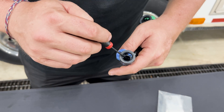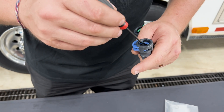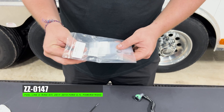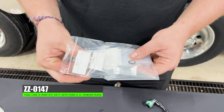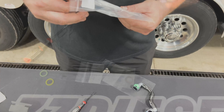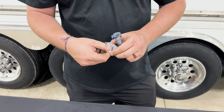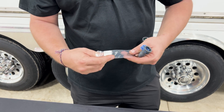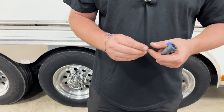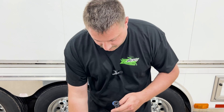Again, there is a separator piece of plastic in there, so you want to locate that and know where it's at. When you grab your O-ring packet, we have them all labeled. This is the short fuel line blue connector side, the one we just removed. You have a black and a brown. We're going to put the brown O-ring on the innermost part. On all the connectors, the brown O-ring will go in first. The easiest way is to get it folded in on itself and start it in there.